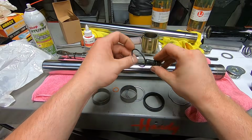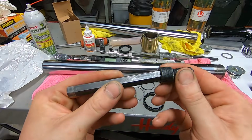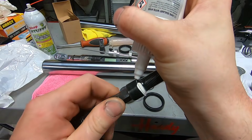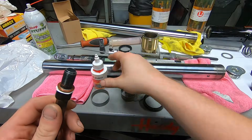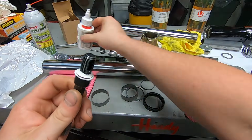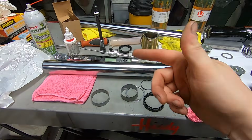And then at this point, I like to prep our bolt and our washer. I get this little cutoff Allen key that slides in there, and take the pipe dope. I like to visually confirm that there's a fat bead all the way around, just so there's no gaps. Slide the washer on, then I push it into that bottom bead and start a top bead, just like that. Then I wipe off the excess for the time being. If any more squeezes out when we go to put it in the fork, I'll wipe that excess off then.